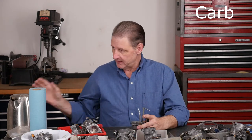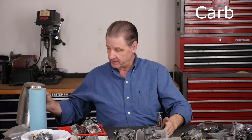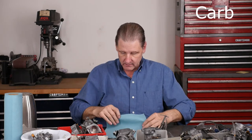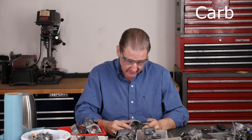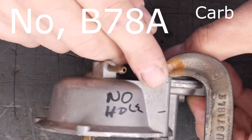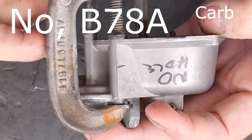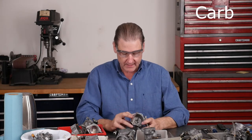Let's pour this out so I can show you the difference — that little boss should tip you off. Reading glasses on. Looking at the markings on the bowl — I believe it says B79A. So we can figure that around 1979 is when they came up with this genius design. Here's the older conventional cap — see how they've got this little ball swedged in here for the check valve? These rattle. And if you take it apart there's no passage for the entry side. The float bowl is different as well — you can see right here where they drill the inlet side. They don't need it now because the outlet has an extra hole that lets the gas in.